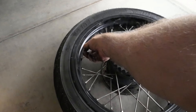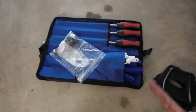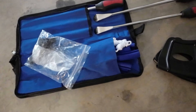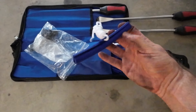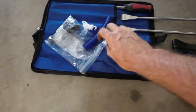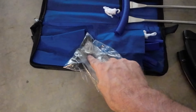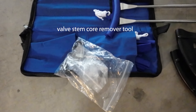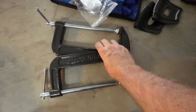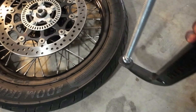Next I need to take these tires off — let the air out, break the bead, and pull the tires off. I bought a kit to do this that includes these spoon-type tire irons, some rim guards, extra valve stems, a stem remover to let air out and replace the stem, and some big clamps to break the bead.